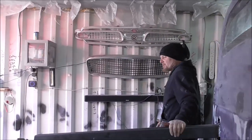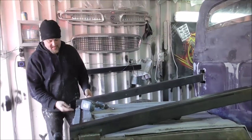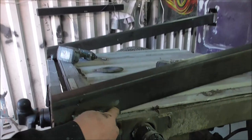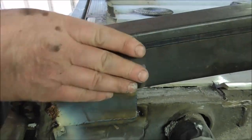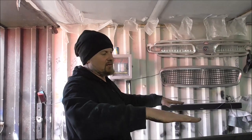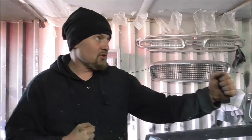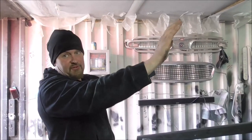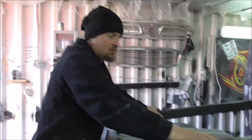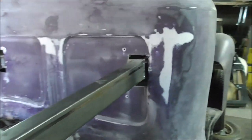we have these two pieces here. Now, these come down, I've tapered them down, welded them to the back of the chassis, and also I've plated them in here. The actual thickness of these is probably a bit of overkill, but the sides of the pickup bed will cover these. If you imagine, these will always be in tension. So if you were to need the seat belts, that bit can't fall forward anymore because we've got these attached to there and they can't move forward.